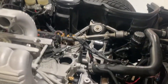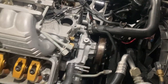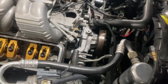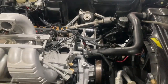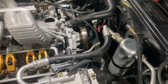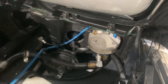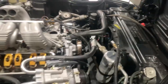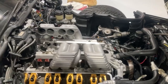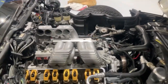We can't even hook the fuel lines up yet because they have to drop through the air conditioning bracket, which is one of the pieces I'm getting coated — just to make it all look like this and look new like the water pump does. This particular car, because it has the blower, has the FMU unit, which is boost control fuel pressure — all mechanical. That has to be put in line and it gets hooked into this. It's sensitive on the boost, and I'll show that later.